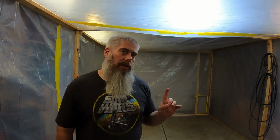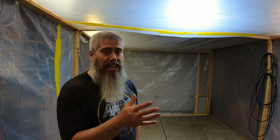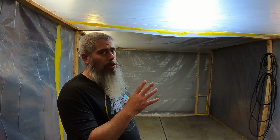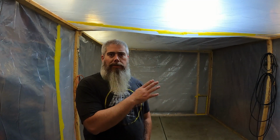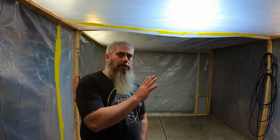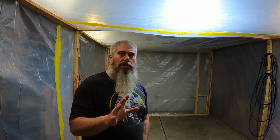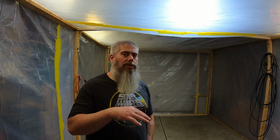Little preview for what's gonna come on the next video when I'm actually laying primer on the car: I'm gonna be doing it in a couple different phases. So the car's blown apart. You can't see it, it's in the driveway at the moment. But I'm gonna be painting from the firewall back, so I'm gonna drop the subframe out, push it in the driveway, paint just the shell of the car, no doors, no trunk, no fenders, nothing. Just the shell of the car, get my 2 coats on it, let it cure just a little bit, hook the subframe up, push it back in the driveway.